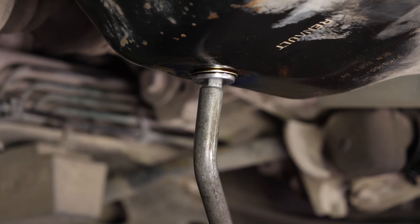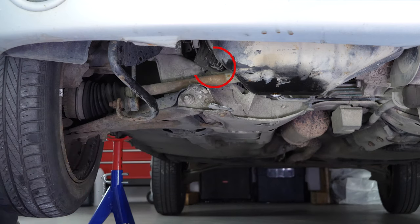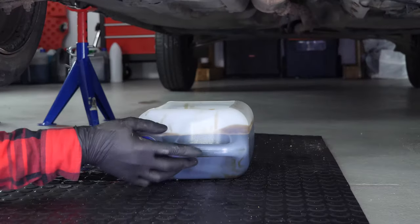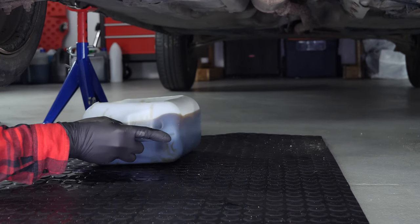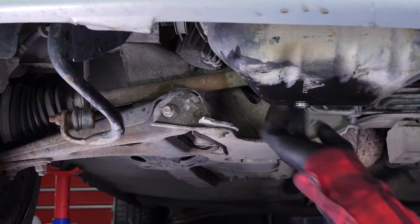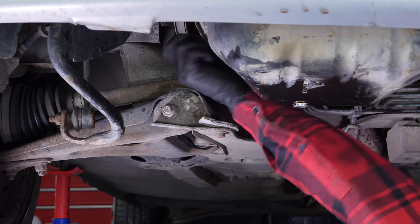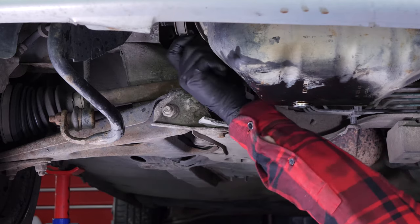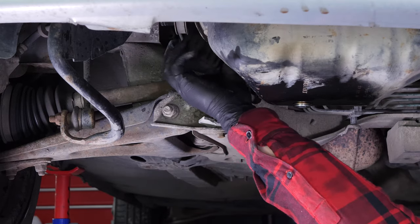When performing an oil change, it is necessary to replace the oil filter. Access to the oil filter is done from underneath the engine compartment. To avoid letting the oil inside the filter from flowing out, place a collector for liquids under it. Loosen the oil filter — if you are unable to do this by hand, you can release it with an oil filter wrench. If the filter remains stuck, see the tutorial on unscrewing a blocked oil filter. Remove the oil filter, and when released, turn it upwards to avoid spilling any oil.